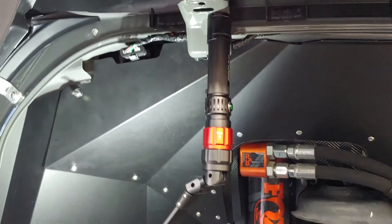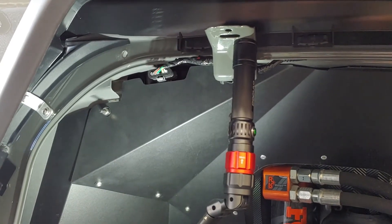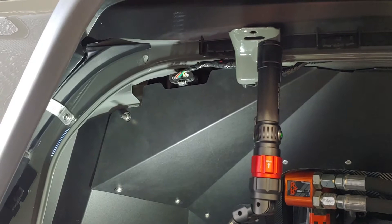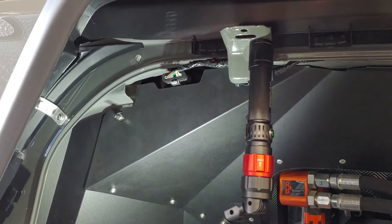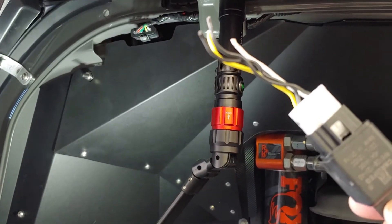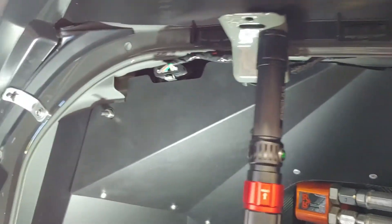The problem with that relay placement is that these relays are incredibly loud when they click. When you touch the door handles with the sensor-touch unlock, you hear a loud click-click because the lights cycle when the doors unlock. It's obnoxiously loud. If you're sitting inside without the engine running and you turn the turn signal on, you can hear this relay clicking louder than you can hear the dash click for the turn signal. It drove me nuts, so I pulled them out and direct-wired it.